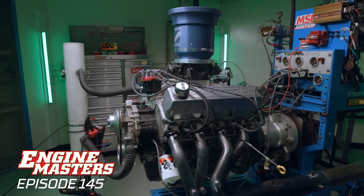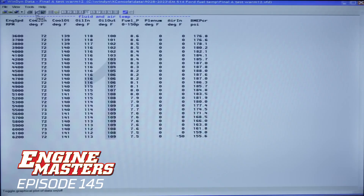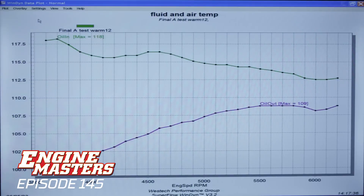In our quest to find out how to cool the gasoline in your car to make more power, we've got our baseline numbers. This is our 514 Ford with just warm fuel. We made 647 pound-feet of torque at 4,500 RPM, and at 6,000 RPM the horsepower was 640. The green line is the temperature in the tank, and the purple is at the carburetor. What's really interesting is to see the temperature at the carburetor get hotter. It's because of fuel flow — we've got this much hose between the tank and the carburetor that's cooling off with the wind on the dyno.